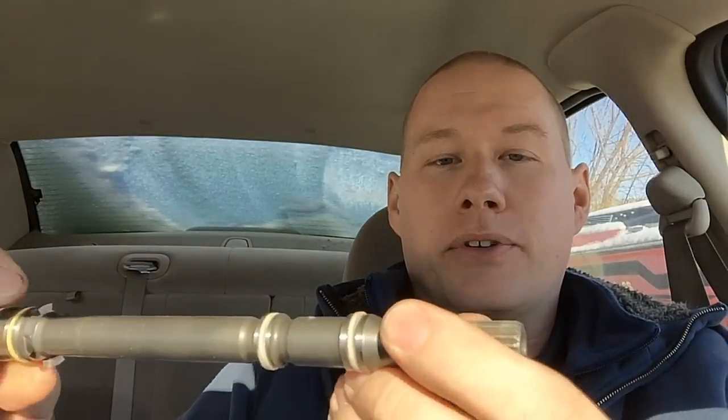The splines on the shaft are just fine, but on the torque converter the internal hub inside strips out. So the torque converter spins around fine as the engine is running, but this shaft is never getting spun — or only occasionally a little bit. It needs to constantly spin to drive the fluid pump and create hydraulic pressure, otherwise the clutches will never apply and you'll never move.